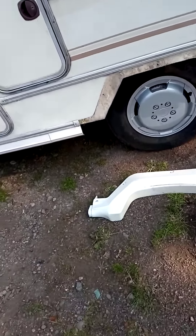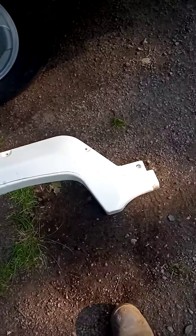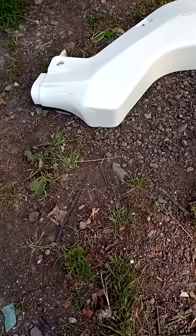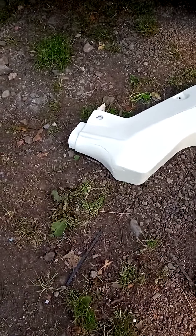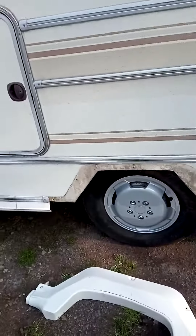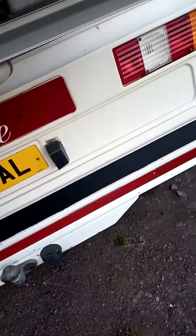Another busy day on the camper. This trim was on there but unfortunately that bottom corner had disappeared — it was smashed off. So I've welded it with my soldering iron to plastic weld it, fiberglassed it, back-filled it, primed it and painted it. Not the prettiest but it's there and it's complete. I painted that back bit because it was white — it's this grippy surface, like a weird tar-type stuff, a really grippy surface.